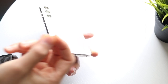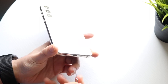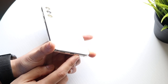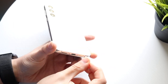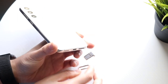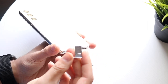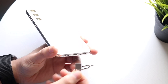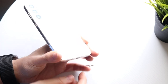If you want to, you can grab your SIM card eject tool, which is in the box — it's just a little metal thing. You input it into the hole that is furthest to the right, closest to the corner. All you want to do is slide it in; it takes a tiny bit of force, you don't have to go super crazy. This little tray will come out and you can input your nano SIM card right there. Once it's placed in, all you have to do is slide this back in, click it into place, and that is it.